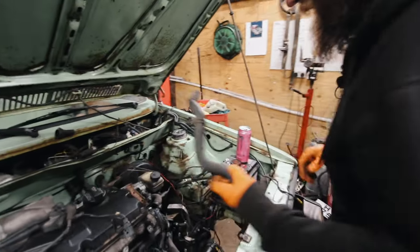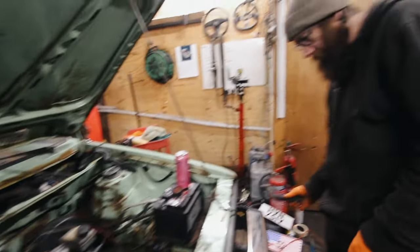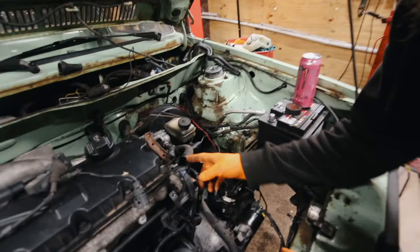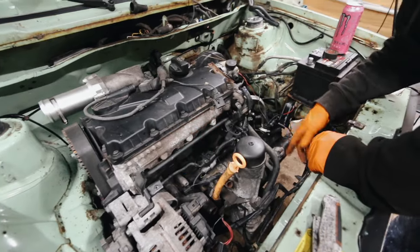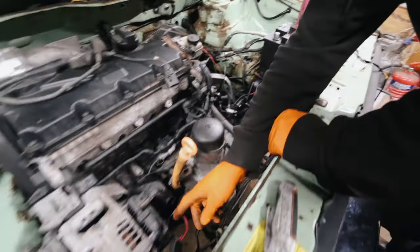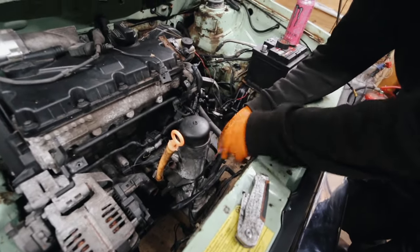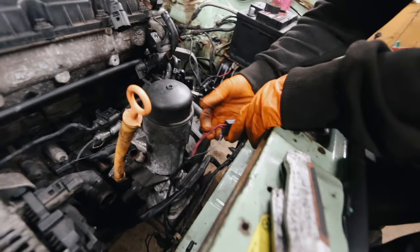Where are we at currently? You've taken most of the wiring from the original loom. We've got the engine harness. I put all that back on, tidying it up to make it look nice and neat. I'm running a new alternator cable because the original one, look how thin the wires are. That one's your light wire, so we still use that, but that goes to the battery.